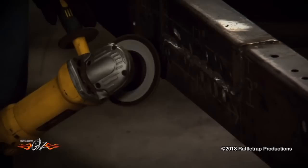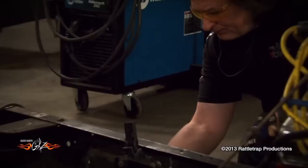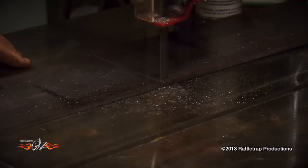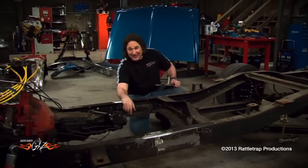Make sure you spend some time here checking and double-checking to make sure the frame is square and straight, because if you weld this thing together crooked you're going to have a big mess. Once it's right, weld it together. Even though the frame is thicker metal, it's a good idea to keep your welds about 3 or 4 inches long and then move to another area so you don't cause warpage in the frame rails. With the welding done, take a grinder and dress the welds down until no one knows they were there.